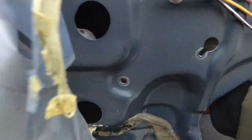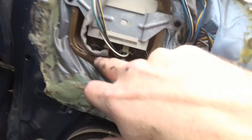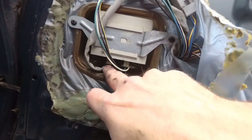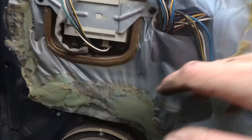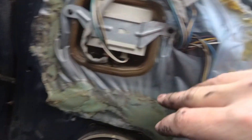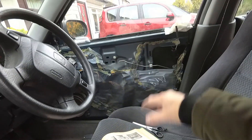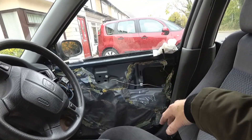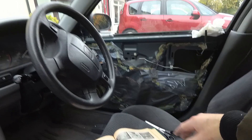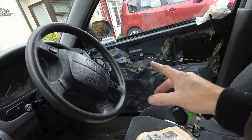I'm just trying to undo the actual motor here with these four bolts — that's hanging loose now. But it's wired up to this little control box, so I've got to try and unplug this plug. So that's how my door is staying for a couple of days. I can't be bothered to put the door card back on just to take it off again, so I'm just going to leave it like that. I've wedged the window back up and by the time this video goes out it will all be fixed.